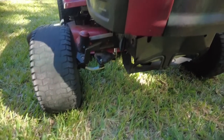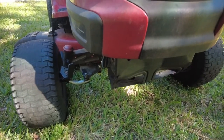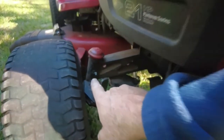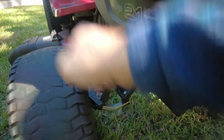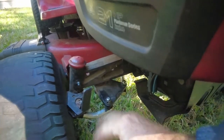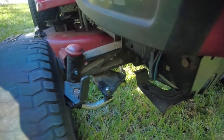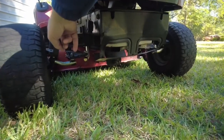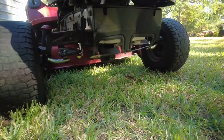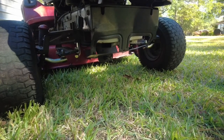I'm going to move this real quick and see if we can see grease coming out. So I just wanted to do a recap from the front of the lawn mower. We've got grease fittings here that allow the front wheel to turn. We've got a grease fitting underneath this that allows this to turn. And we've got a grease fitting down in the wheel that locates the wheel, so as the wheel turns it's lubricated. We've got one, two, three on each side, and then there's one on top of each spindle. Those are the locations to lubricate on the riding lawn mower.